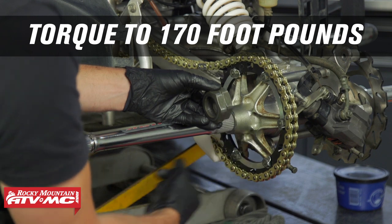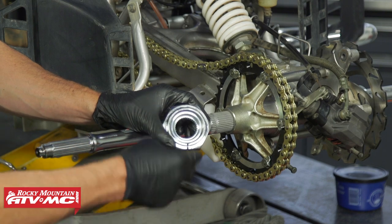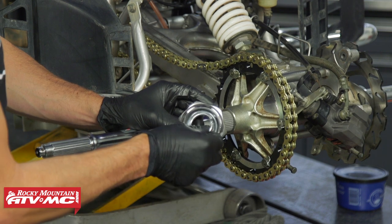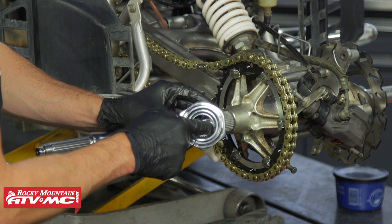For anyone using a Tusk axle, you have a three-piece lock nut. The inner piece on the lock nut will rotate and the C-clip fits inside of it once it's on. Make sure the step in the inner piece is facing out toward the wheel.